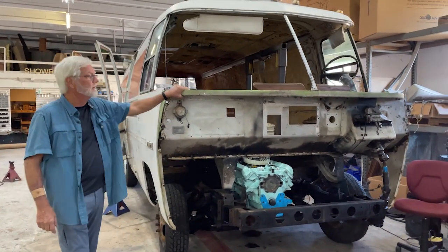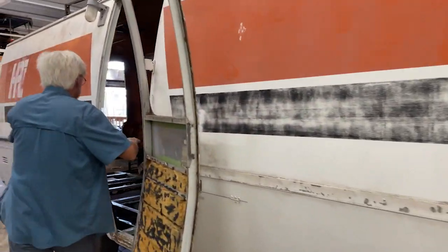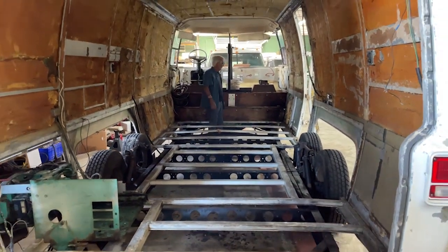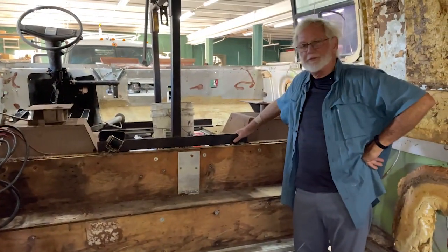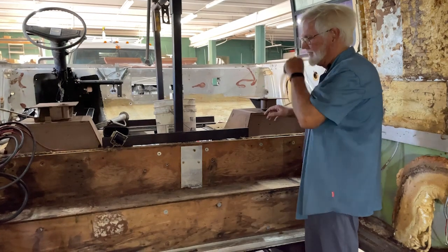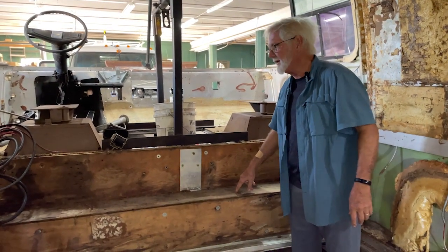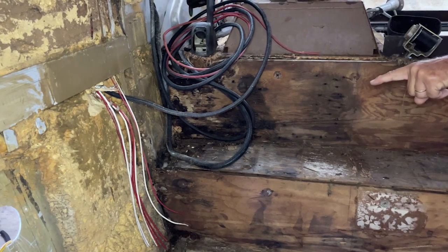Let's go inside this baby. We've about ripped it all out. Come on in, I'm going to show you some stuff about the floor. Just a little bit of wood left. Here it is — this is the wood floor in the cab of the coach. Wood is a very good insulator, and in this application it's a good place for wood as an insulator. The problem with it, if you look over there at the corner, how it's all eaten out — that's what happens because the A-frame window goes right down there and rots it out.